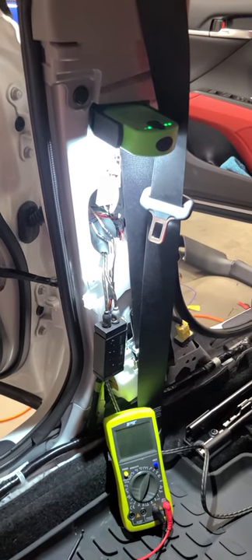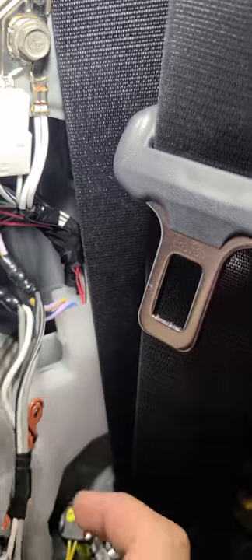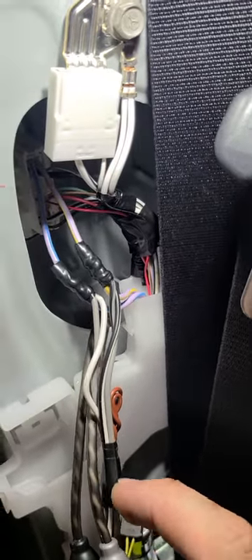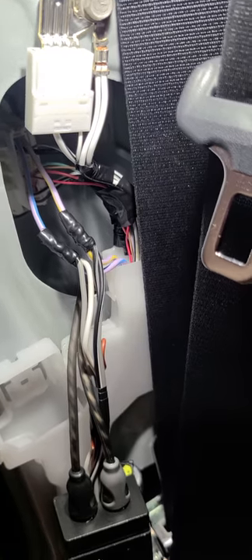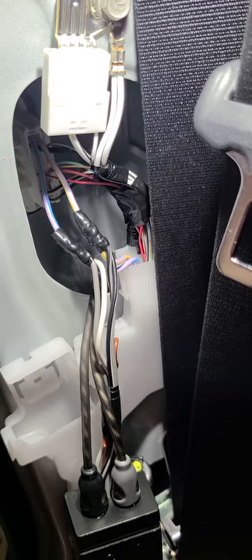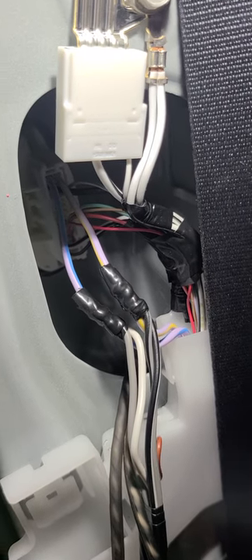I'm in the car's B pillar. It's where I'm going to grab the speaker signal input, and I've tied the left and the right channels together because the monoblock amp receives one signal. It's kind of a purple lavender color for the speaker wires.